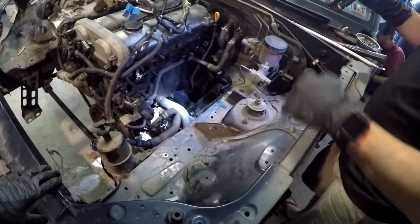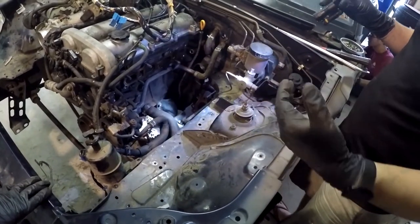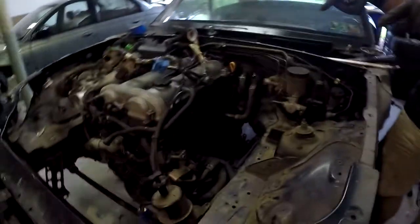Think about that magnified with the amount of torque the engine can make — and that's a naturally aspirated engine. If you throw a turbocharger or supercharger on here, those mounts are just going to get torqued all to hell. You're going to need different style mounts to hold together the power you want. That comes with increased vibrations, but you won't have a turbo downpipe slamming into bodywork with the engine jumping all over. You want to either get the Mazda Competition mounts — one for each side — or go with AWRs, which are very stiff and will give more vibration but keep that engine planted.